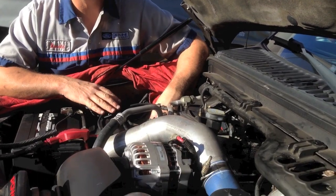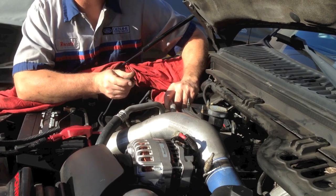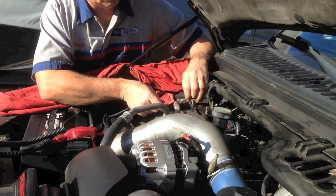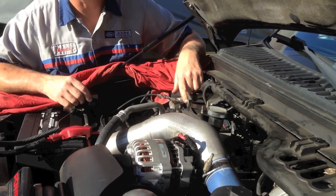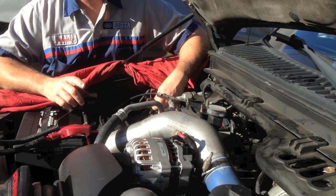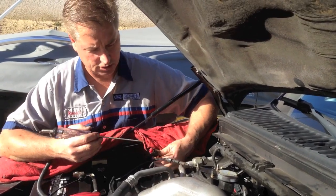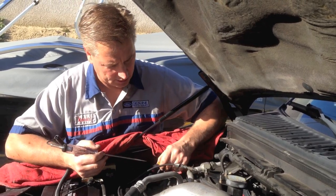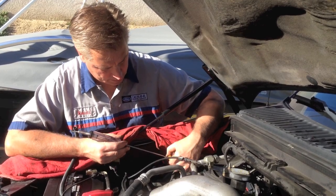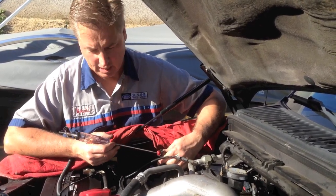So the main thing — if your pump's not running, what you can do to see if it's capable of running is pull this off; that'll get it vacuumed and start going. There's a vacuum line here — it's a splice that feeds the inside. Now if it's not running and your key's on — remember, always key on — just check for power and ground. Right now I have my test light hooked up to the negative. I'll touch it here on the bottom one, the black with the orange stripe — it might be green with an orange stripe — and I check it: I have power.